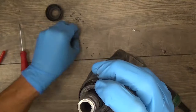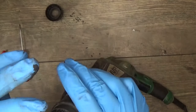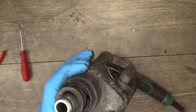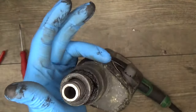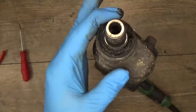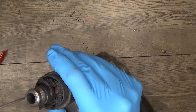Normally the ball must be here — the ball holds the drill bit. But not only the ball; there are also two pins inside the tool holder. I'm still removing the ball. The washer with a groove for the ball. Spring. And of course a lot of grease with dust. It looks yummy.